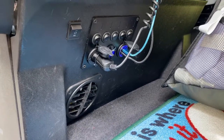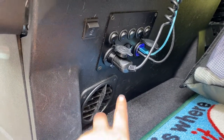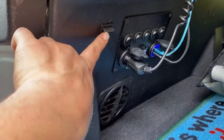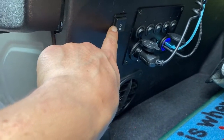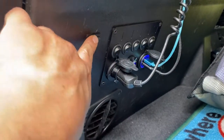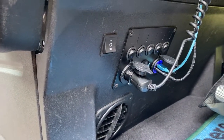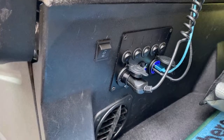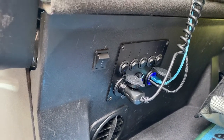This is behind the passenger seat. I've just got a little basic fuse panel — the customer only wanted USBs and a 12-volt socket, so one of these is ideal. The heater outlet is here. And this is effectively a rocker switch. The way we've wired it: if it's in the middle, it doesn't give any signal to the DC-DC charger. If it's on position 1, it wires the D-plus to positive and also connects the low-current wire, which means it'll run at 20 amps rather than 40 amps. And if we go to position 2, that'll run at 40 amps as soon as the battery is detected at more than 12.9 volts.